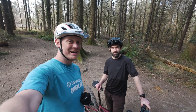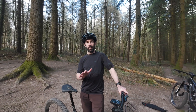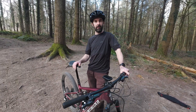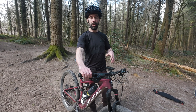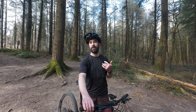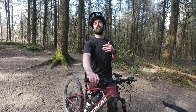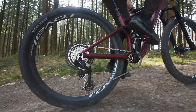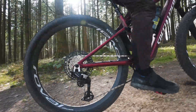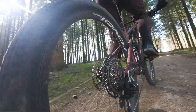Rob has had Eagle 90 on his Specialized Epic for about a month, clocking around 250 kilometres. Starting with shifter feel - it's nice and positive but there's a bit more to push through, so it's a slightly softer feel than Shimano when shifting up the block into an easier gear. However the release on the thumb paddle is quicker with less travel compared to a Shimano shifter. Being a cable there will be some stretch, so you need to tweak the tension until things settle down.